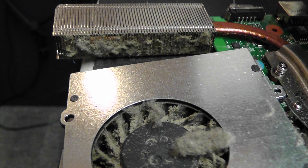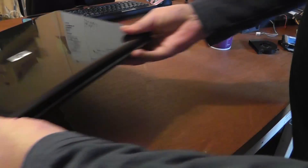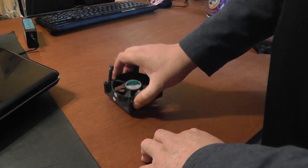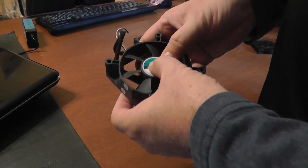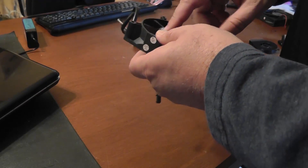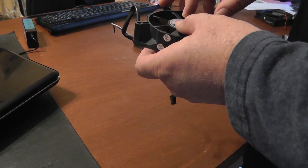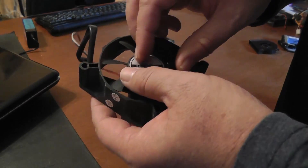If your laptop is overheating and your fan is spinning fast, that's one sure sign that something's going on there. Now let's move on to fan noises — like a whining, rattling, or screeching noise. We're going to start off with some desktop fans here. You'll get sometimes with these fans, laptops and desktops, a type of screeching noise or a rattle or a whining noise or something like that, and it sounds like the fan is about to go out. But this particular one here is a ball bearing fan.